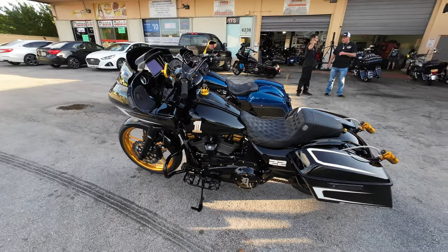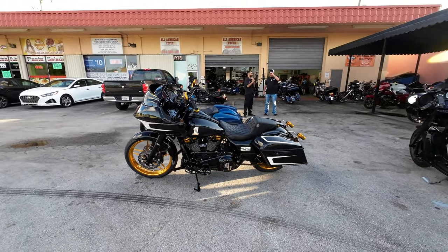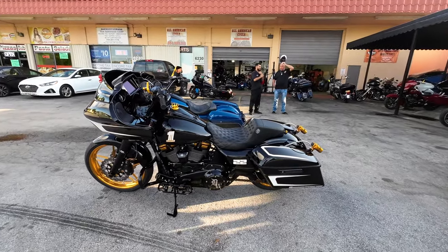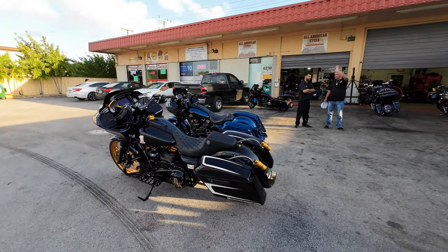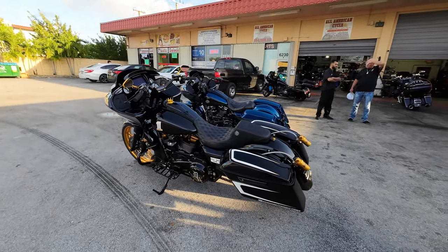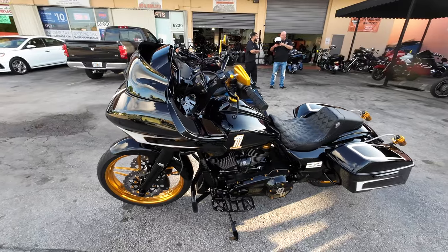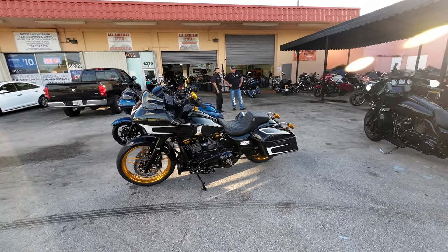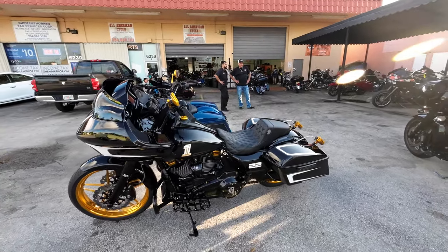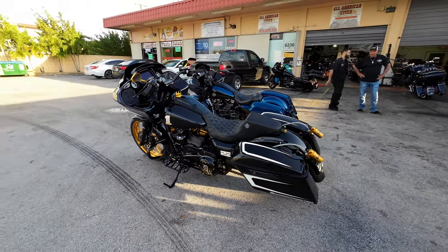So I knew that going into this that I'd probably be down a few horsepower, and actually I was down exactly that. I was down 5 horsepower and 5 foot-pounds of torque from my previous dyno tune here at All American Cycle when I came down here the first time. After talking to George, he definitely thinks that this pipe is great. I didn't lose the power because of the pipe. I lost the horsepower numbers and torque because of the chain drive and the Shinko hookup sticky tire that I have on the bike. So I'm super stoked with how everything turned out.